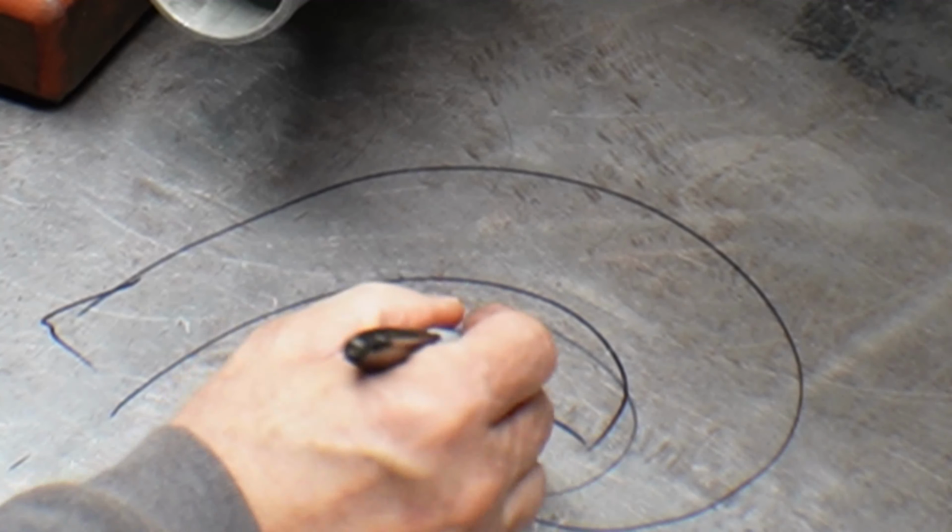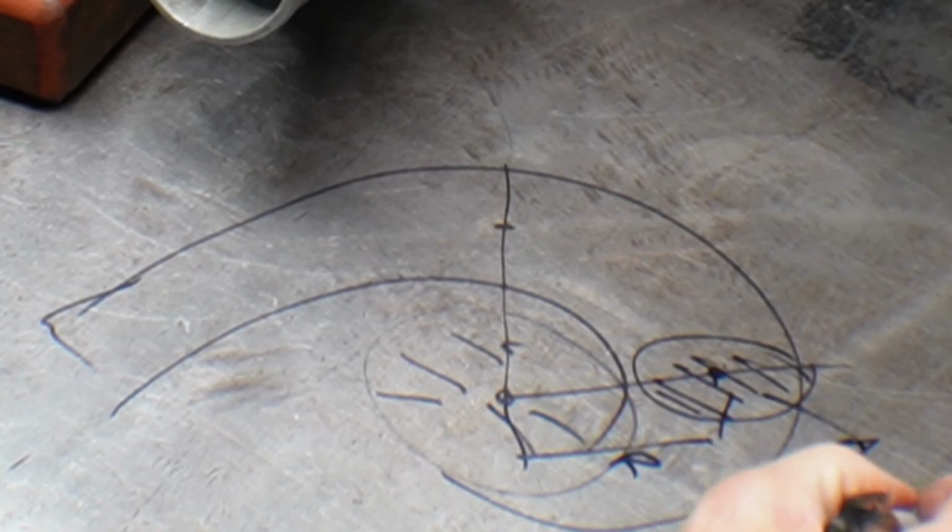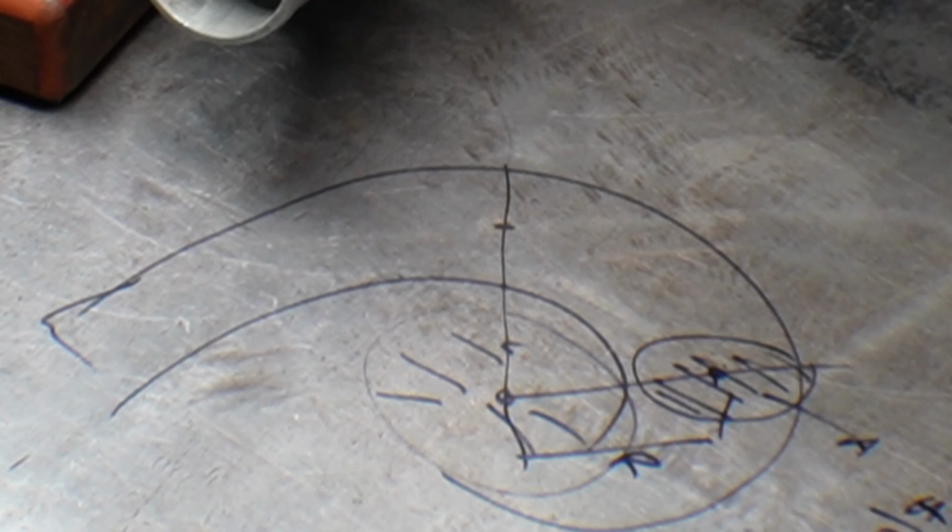So if you take a cross section through any place on this housing, the center of the area, let's say this area is round here, elliptical or whatever, the center of the area, that's your R, and this is your A. This is the area of all this stuff in here. So A over R is equal to 22 millimeters, right? So if this is 10 millimeters, that's going to be 220 square millimeters in area. And anywhere you do that, it's going to be constant, right? This is a constant A over R.